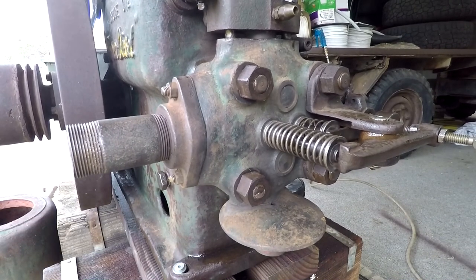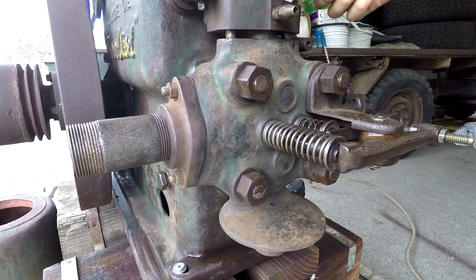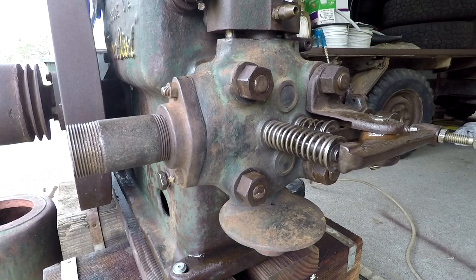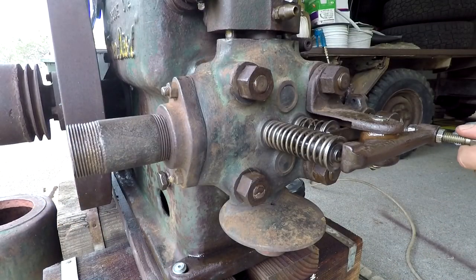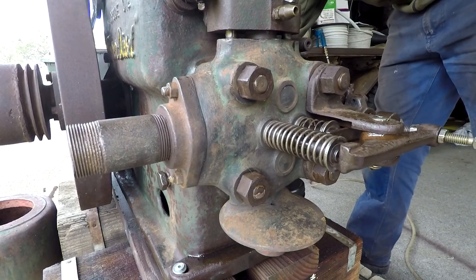Okay, so I can't really go any further than this. I don't have the stuff to fabricate this arm. But I'm just cranking over then. It actually is combusting a little bit of oil, and that's probably in there. So that's a good sign. Means I've probably got my timing roughly right. I'll crank it over to show you.